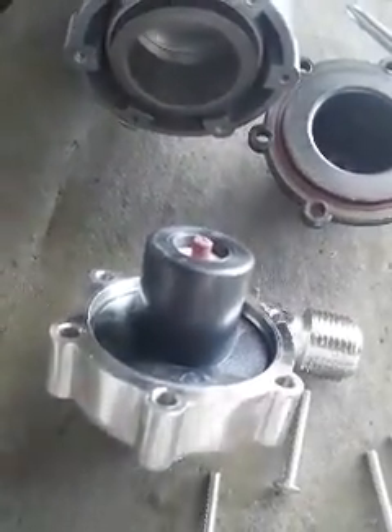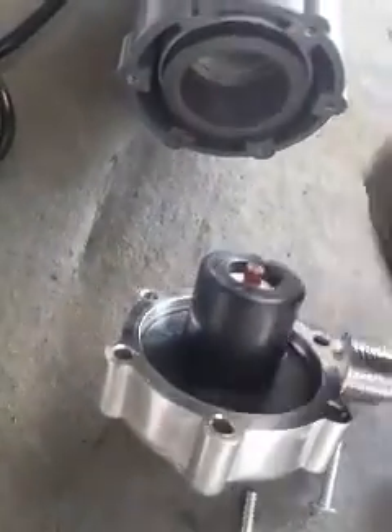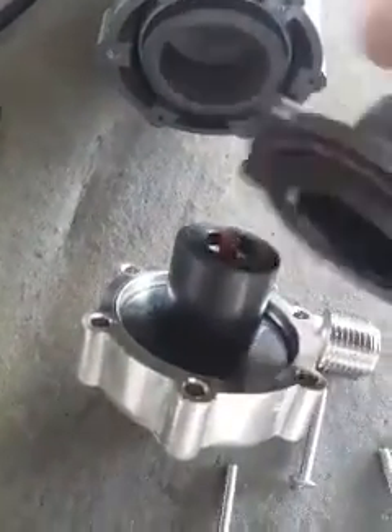The impeller goes on to the head like that. The impeller cap — this is what separates the liquid from the pump — that goes like that. Then realign the pump going upwards, get all the holes lined up, and then put your screws back in.